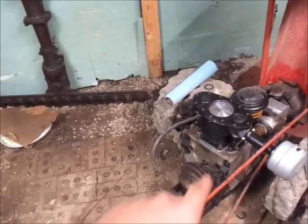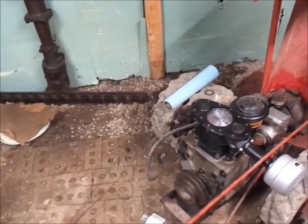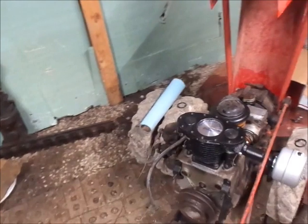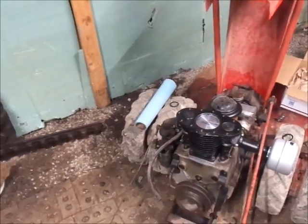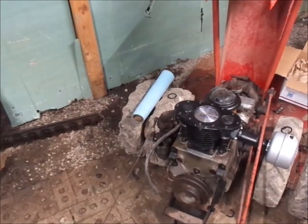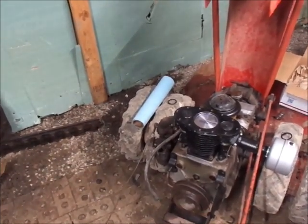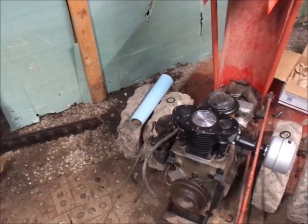Actually, I'm glad I got the camera out of it. I forgot to tighten the screws for this side. But I have installed the new cylinder with new piston, and it has new valves and all that jazz done to it. I've adjusted the valve lash. Got both intake manifolds on there with new bolts, gaskets, and hardware.